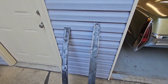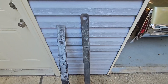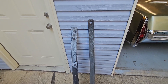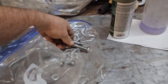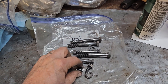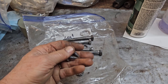Up next we'll do a metal prep on this and then get some primer on it. Here are the two bottom leaves off the leaf spring - I've already done the metal prep job on these, got a nice gray haze right there. Doing them one at a time: clean them up with a razor blade, flap disc them, metal prep them, then prime and paint black. I went ahead and zinc plated the leaf spring parts as well and they look pretty good. There are the four main bolts with lock washers - turned out really well.